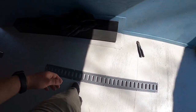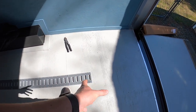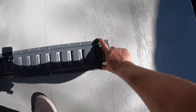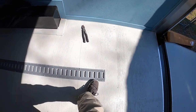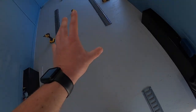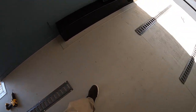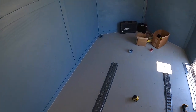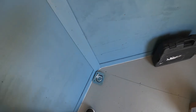Every 16 inches I have a bolt going directly into the supports. Anywhere I couldn't hit a steel beam because I didn't have enough length — like here, for example, where the 16-inch mark is but I ran out of E-track — I just used heavy-duty wood screws there. I'm not too worried about it; I'm going to try to avoid mounting the little clips where there are only wood screws and stay where there's steel. The machine is going to sit in the middle most of the time, so I'll probably strap the front strap up to here, which is a steel beam, and the farthest back a strap will need to go is right here. When we have two machines in here, we're going to use flush mounts where we'll drill a hole into the floor and mount into the steel beams as well — and that'll be another video.